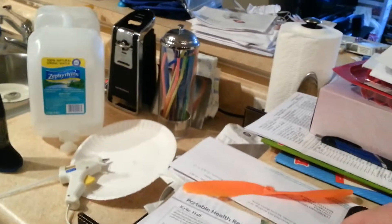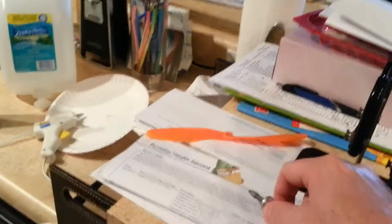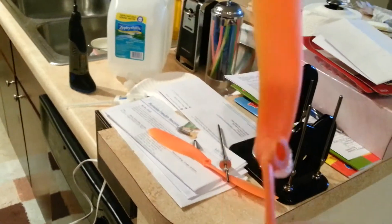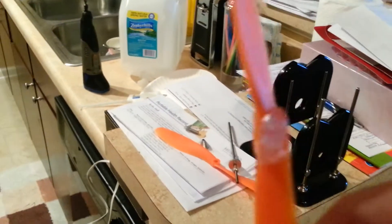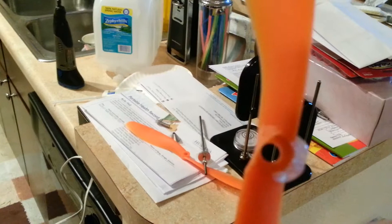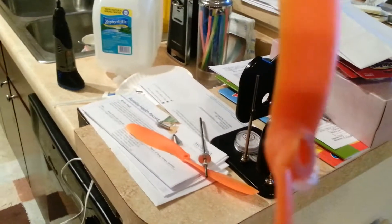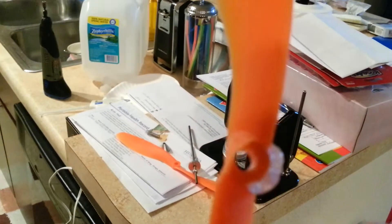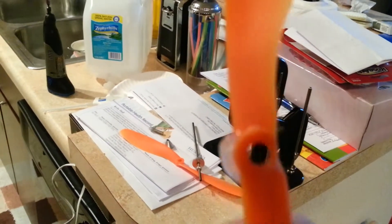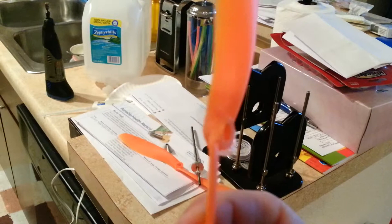Let me show you another prop — I have another Gem fan, same prop. These are 845s. This other one is a mess. I started out with adding weight to the hubs. First I tried using some CA glue, and it didn't seem to help too much — you have to put on a lot. Then I started getting the Dremel out and grinding it. I know that's not perfect, not great. You're taking away material from the hub, which ultimately is weakening the prop.